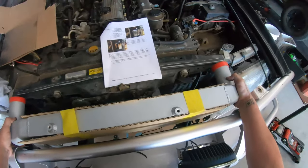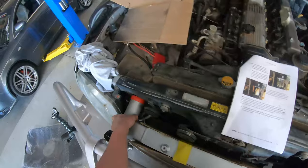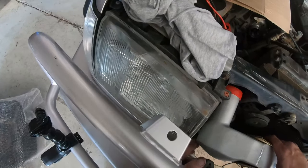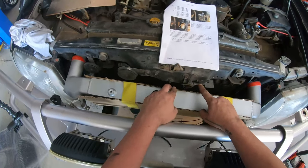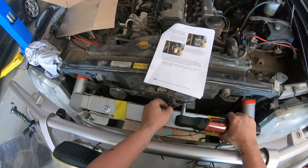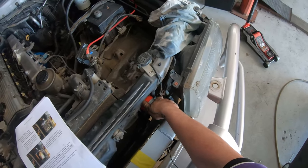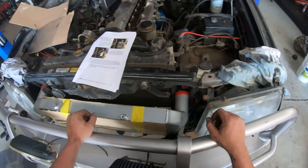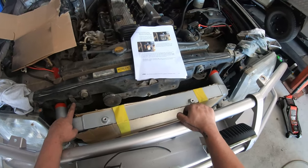Okay, first test fit. Be mindful not to touch anything — should squeeze down in here. Wow, this is a tight fit, they weren't kidding. A bit of massaging needs to be done — it's touching on the headlight bracket just there, and this side is jamming in this end bit here. To get that to go forward I might actually remove this latch so that's not in the way. I think we're going to have to pull the headlight out to get this to go in correctly. Now as for fitment I thought this was a bit weird when I was reading the instructions but I now understand — I have to move that horn to get this to go in where it needs to go.